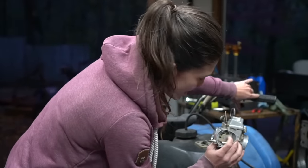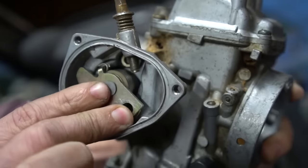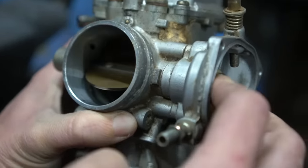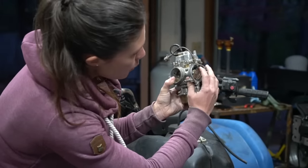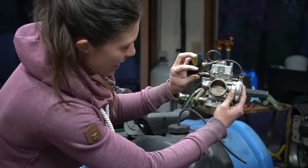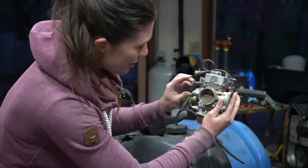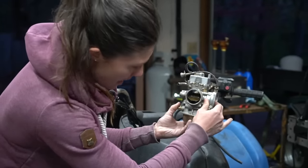When Jason and I hooked this up, I realized that the throttle cable basically controls this little valve — when it rotates, this valve opens and goes right to the air filter. Sure enough, when this is wide open, air is flowing right through there. And when we hooked up the fuel lines, I realized the gas starts to pull down here. So if you're pushing the throttle cable down, there's tons of gas going in and then tons of air.